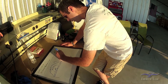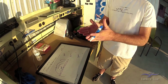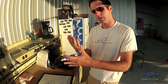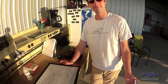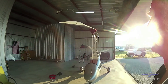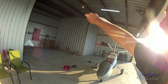Every portion of the rotor has the same force from under the rotor - it takes upward flow. That's the way an auto-gyro flies. It doesn't matter if you're on the stalled portion or the driven portion; that same amount of airflow is coming up from under the rotor system. But the difference is the speed increases as it goes down to the tip, which effectively lowers the angle of attack of the blade because it's going faster against the same relative wind to the gyro. This blade actually has an asymmetric airfoil - it's cambered on top, flat on the bottom, with a little bit of reflex. That creates positive lift.